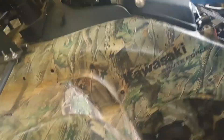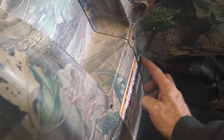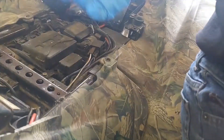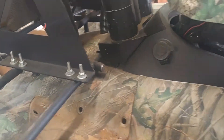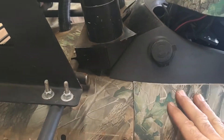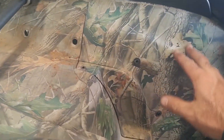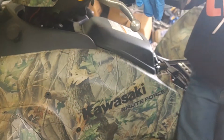This bike is older but it has a storage compartment cover with a couple bolts in there that you have to take off. We've got those off. We also removed three bolts down through here to get this side cover off, as well as three bolts on the back - two here, one at the top. Same thing on the other side. There's also a bolt hidden here. This bike has snorkels, so there's also a bolt up here at the top you have to remove. On yours, if it doesn't have snorkels, there will be screws hidden here and here to get the side covers off.